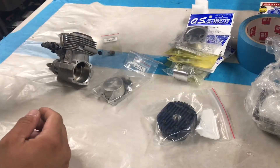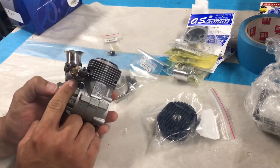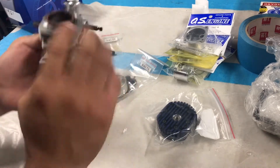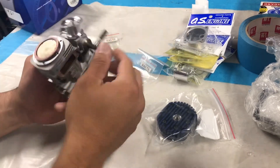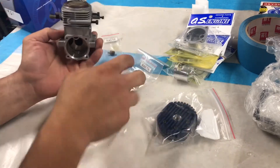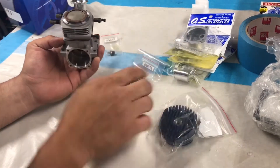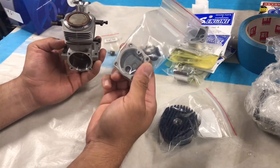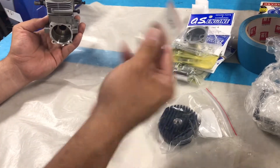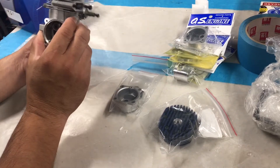So I have a 105 — it's the HZ version — so you'll see there is no regulator on here. It was actually completely apart but I put it back together just to show you how the disassembly process works. I left the head off with all the screws in the bag, and also the back plate and back cover off, and also the glow plug — you could probably replace that so you don't even really need that.